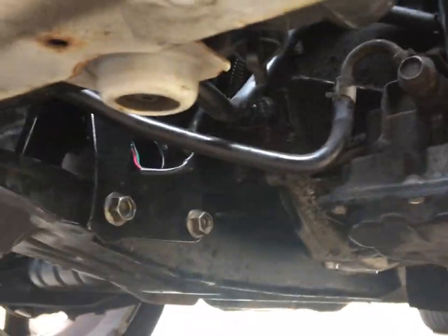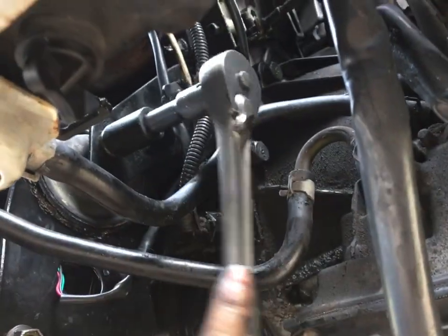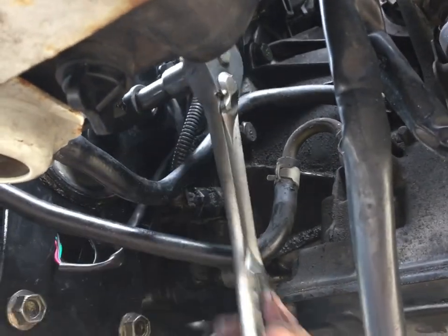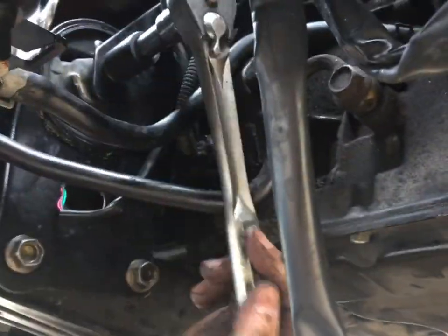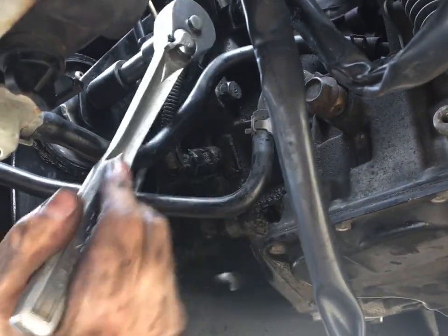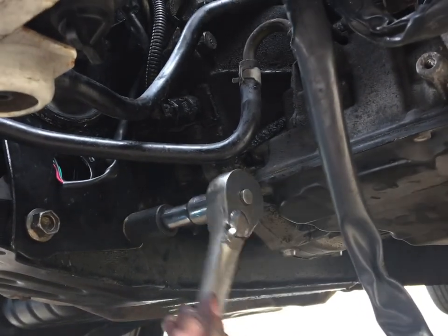But the only thing I'm gonna do is go in now and just finish tightening up these bolts by hand, because the instructions said not to use an impact wrench, probably because they're afraid it'll damage the electronics on this electric motor mount. So I just got to get this isolator one tightened up, and then I got to come in and tighten up the two cross member bolts.